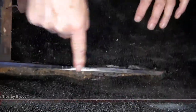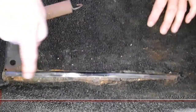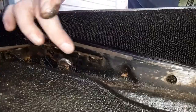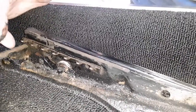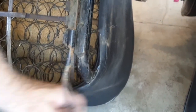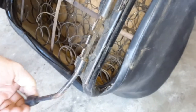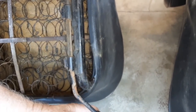As you run your fingers along here, these are nice and straight — they've never been tweaked. Our '67 had a little bit of a ripple to them, this front one kind of did a banana curl up there. And these here are your little locking tabs over your seat adjusters. It's nice to check to make sure those are in good shape — these are very vital to keep the seat in place when motoring down the road. Before you put your seats in, these are your locking tabs and you want to make sure those are really in nice shape. They are spring-loaded — lots of times the spring's either broken or missing. These are really nice. They pull down and it's locked. Then when you want to move your seat, just slip that puppy up and slide.